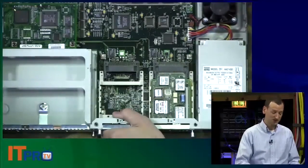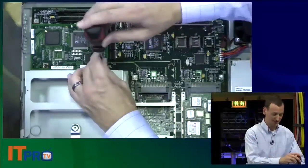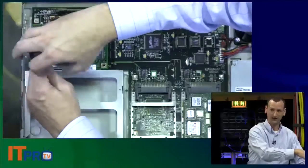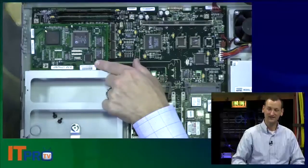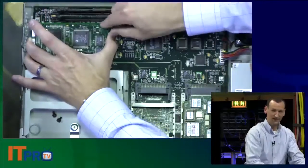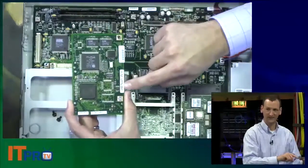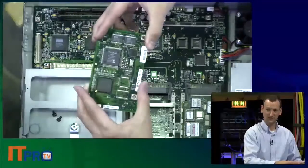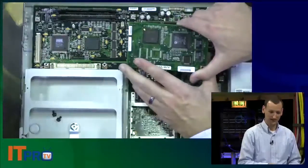There are some cards that don't go into an external slot but instead go inside. This particular router has a VPN accelerator board — that's this board right here. Most of us terminate VPNs on a firewall like a Cisco PIX or ASA, which has VPN acceleration built into the motherboard. But on a router you don't, so if you need it and you're going to be doing heavy VPN work, you can buy a VPN accelerator board. This one is labeled AIM VPN — the VPN Add-In Module — with special circuitry designed solely for VPN acceleration. It pops right onto the motherboard and adds that extended functionality.